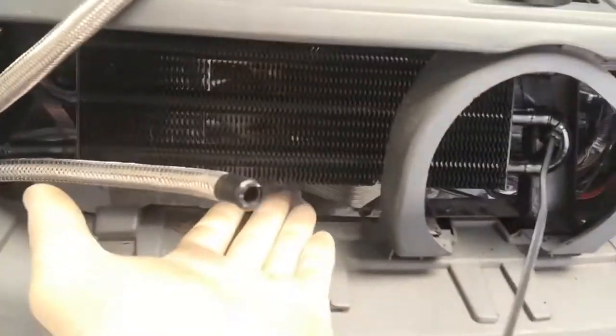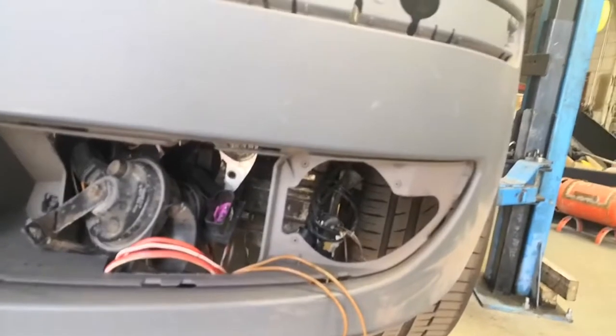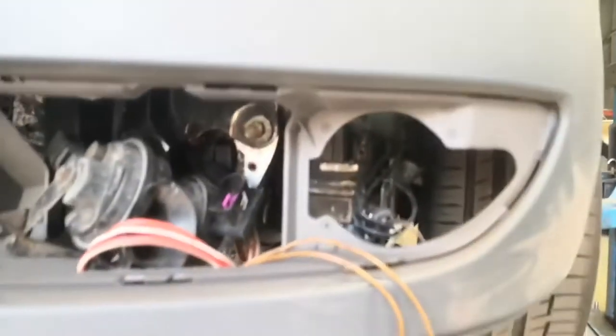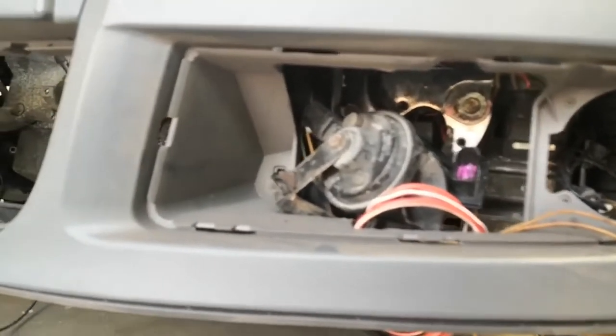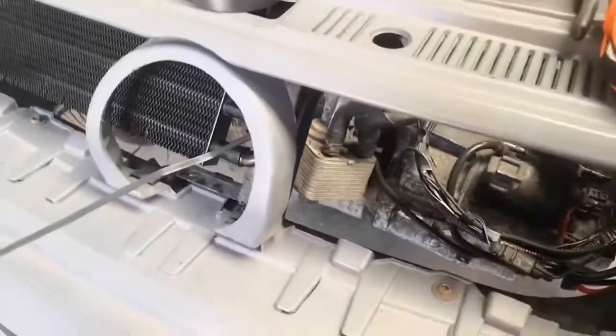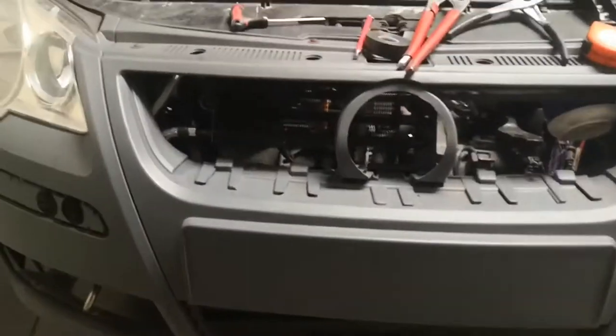Another reason I wanted it where it is - there's no room down there because the intercooler is going in front of the radiator at the bottom. This side might have an oil cooler but it's a bit too busy down there with the horns, the power steering, and there's also going to be a boost pipe coming through on both sides. So the oil cooler is going there, fuel cooler there, radiator at the back of it all, and then fans on the back of that.